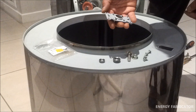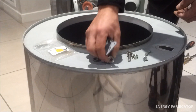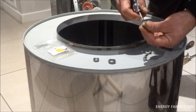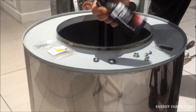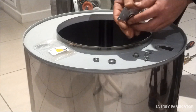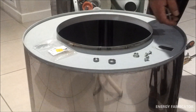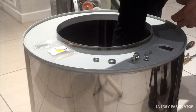I've got the new drum bearing kit here - the main bearing mounted on a plate assembly, and two new spacers: a small one and a larger one. We're going to reuse the old bolt and old screws, but this time instead of just tightening up with the ribbed washer, I'm also going to use Parker TL55, an anaerobic compound medium torque thread locker. That'll help lock the nut in position because when I took this apart the nut was just sitting loose on the end of the bolt - the whole thing had wound its way undone and it turned into a bit of a disaster.